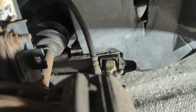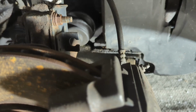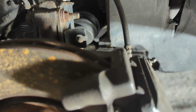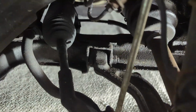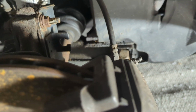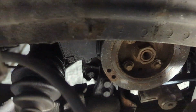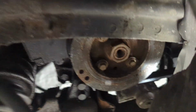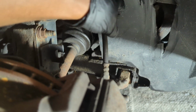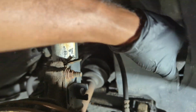It's the 3-bolt control arm. And you got to load those things. So I need to find a jack or something to load this thing, or put the jack stand under it, because other than that you'll tear up the bushings and the A-frame portion of that. And he's got some kind of leak going on down here, tearing up that mount and leaking out of that timing belt cover. So I'll pull that timing belt cover, find some more work to do.